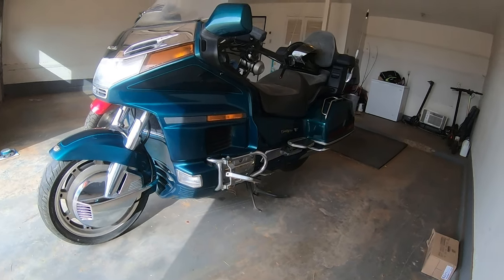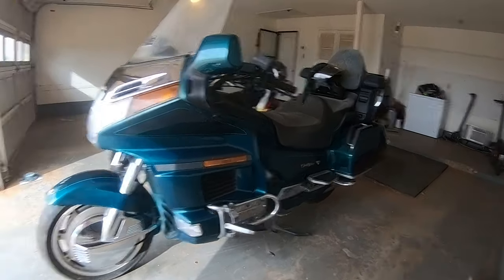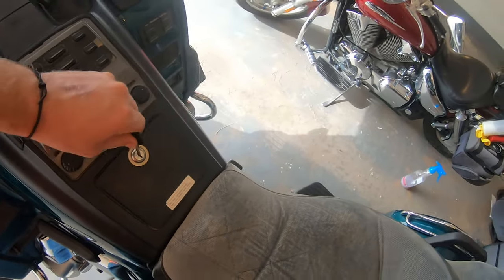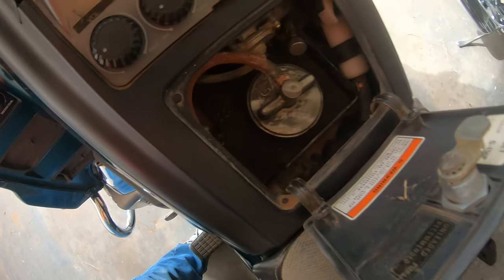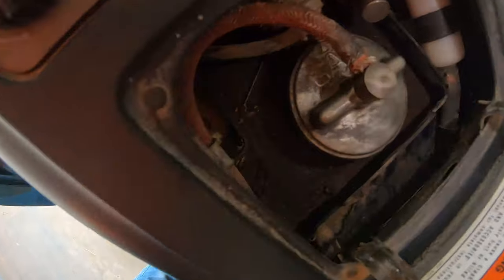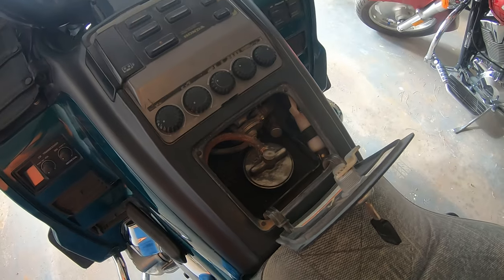So today, as it suggests, we are going to be fixing a leaking petcock on this GL1500. If you saw underneath the motorcycle at the beginning of the video, there was gasoline on the ground. It was just a little bit, but there was still gasoline, and this little drip pan underneath the petcock is soaked. All of that is gasoline, and I believe it came from the petcock. That was my diagnosis, and so we're going to go ahead and rebuild that bad boy.